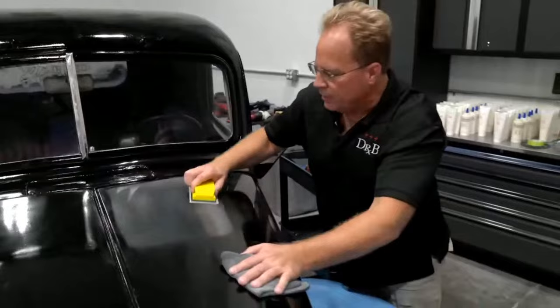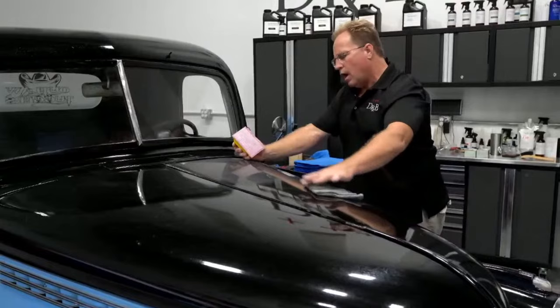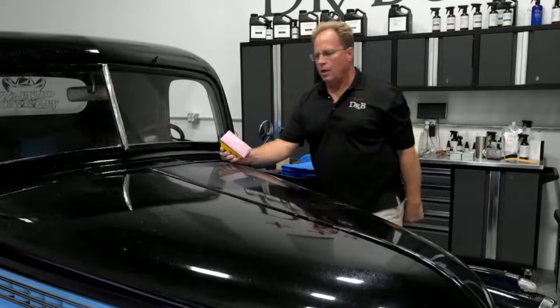Okay, then after you've sanded to the point where you look at the paint and you can go, you know what? That looks good to me. I've leveled the orange peel. I'm not going to get all these dirt nibs out of here. I don't know how much clear is on here. I'm hoping it's got some paint because my students are going to find out if it doesn't. The good news is the guy that owns this, who's probably watching, he doesn't care if we make a mistake. These aren't high-dollar street rods he buys and sells. Boom, here we go. That is sanded, hand-sanded.